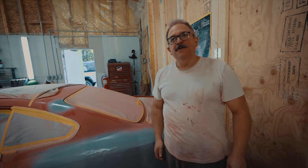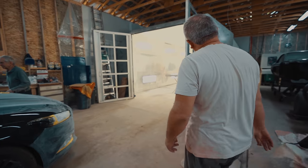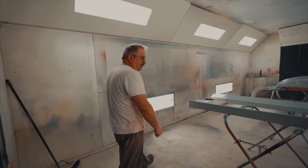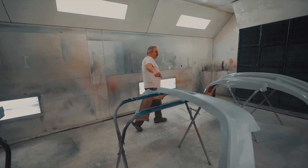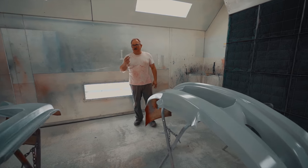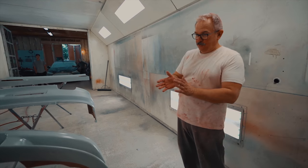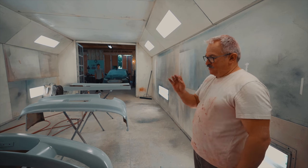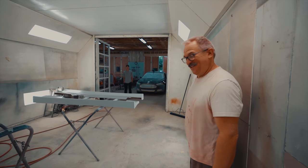What I'm doing right now is repairing the body kit and applying the hydro primer. On these two parts I have two coats of high-build, and on this part only one coat — I still need to apply three coats total of high-build primer. Then we use a straight block and block them nice and straight until there's no more imperfection and it's just perfect. That's where I'm at right now after the progress on every piece.